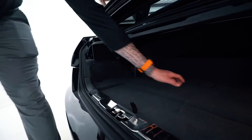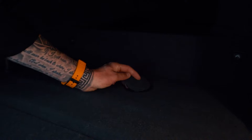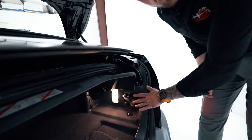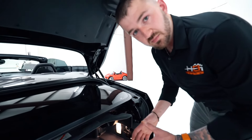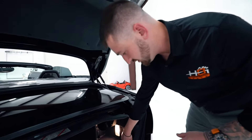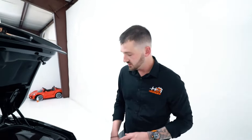There's also some storage back here where you'll sometimes find the owner's manuals. This is the port to access the gearbox to disengage the parking brake if needed. Regarding the tender port mentioned earlier — my recommendation is that any time this car sits for more than a day, keep it on a tender. These cars have a constant parasitic drain on the battery, and if the charge drops below 12 volts it causes the car to run rough, fault lights to come on, and a lot of other issues.